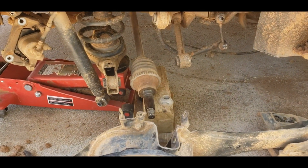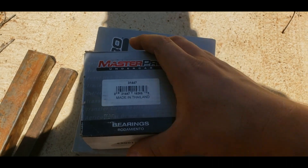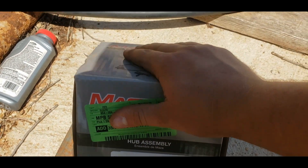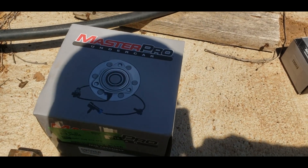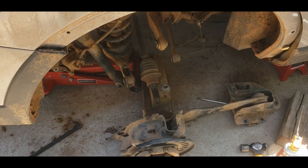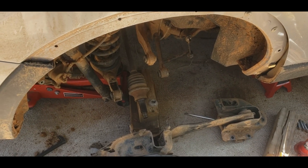Part numbers for the hub assembly: this came from O'Reilly because time was of the essence. This is the bearing and hub for the front — the part number is on screen — and it's the same bearing. This is for a Mazda CX-9 all-wheel drive. The front-wheel-drive-only version is a lot easier to deal with because you don't have that rear shaft coming through. On this one, the transfer case is shot and AWD is never going to work because transfer cases have been on national backorder for three years, so you have to leave everything in because the sensors are tied to it.